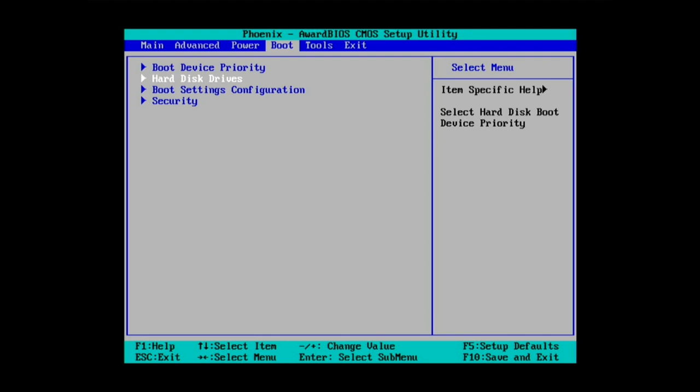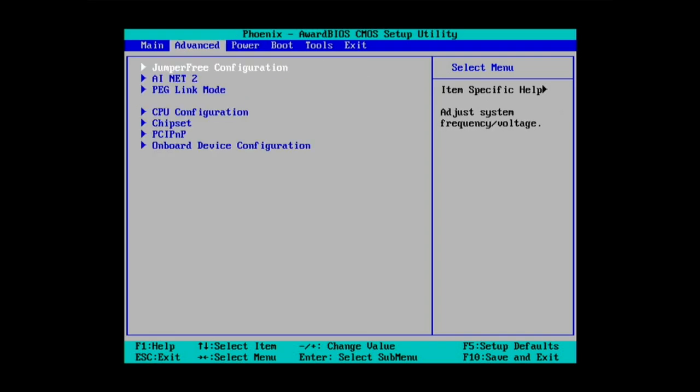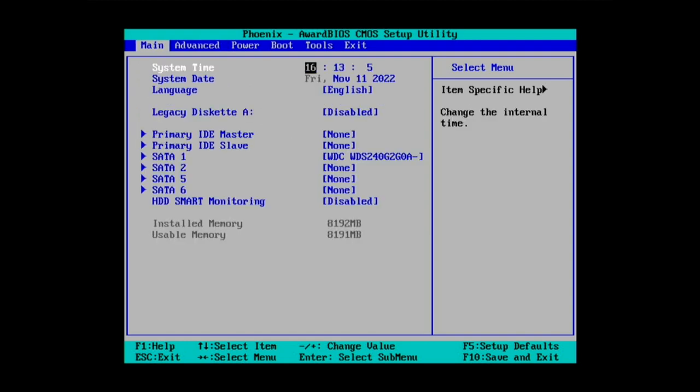And also one more thing about this motherboard. It might be my Vista image, but that works on my Gigabyte M2 board and so on. But on this one, I cannot get Windows Vista Ultimate installed. It will crash with a blue screen at a specific point before you can create an account and stuff. Windows Vista Home Premium doesn't have that issue, so I don't know. I had an install of Windows Vista from my other motherboard and just put it into this motherboard, because they both have Nvidia chipsets from the 500 series.